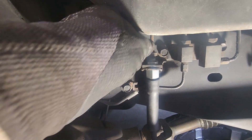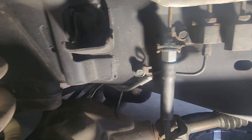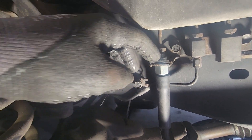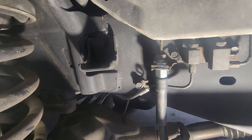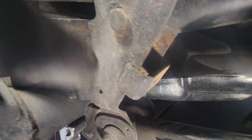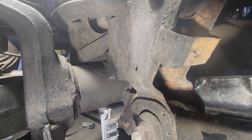So once again you're gonna go through here through the brake line, push this tab — that's what holds this in place — and then you just tighten this like you normally would, righty-tighty lefty-loosey. Like I said, if the truck has been sprayed or it's been on there for a long time, this is gonna look like one piece. If you don't know this tab has to come out for you to pull the hose down, you're gonna be struggling.